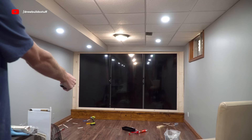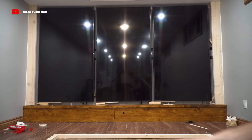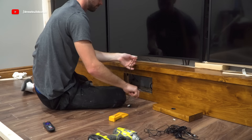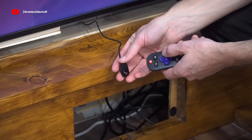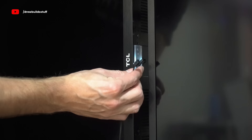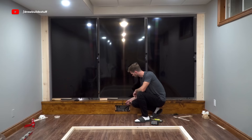When the frame covers up the infrared sensor on one of the TVs, the remote signal obviously won't get to it, so I'm going to have to install one of these IR repeaters. There's one cable that plugs into a box that will sit outside the frame to collect the signal from the remote, and then I'll plug in three more cables that repeat that signal — each one stuck right onto the IR sensor on each TV. This way one remote will control all three TVs.